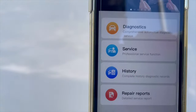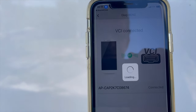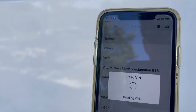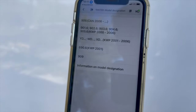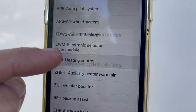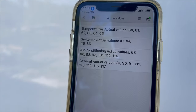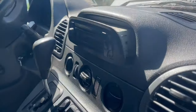I've started the van and plugged in my AP200. I'm going to go into diagnostics — Ben's Sprinter — manual selection, Sprinter, 901 for a T1N, USA, OBD, control unit. Scroll all the way down to HZR, heater control. Live data, actual value switches. We're going to check all this out just to verify the control module here is good.